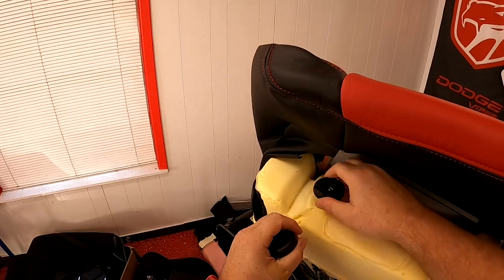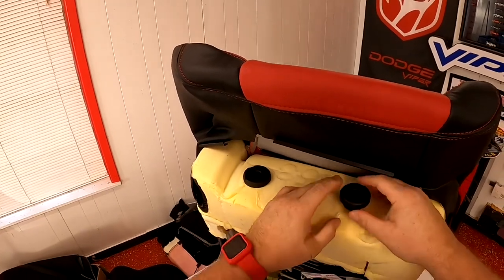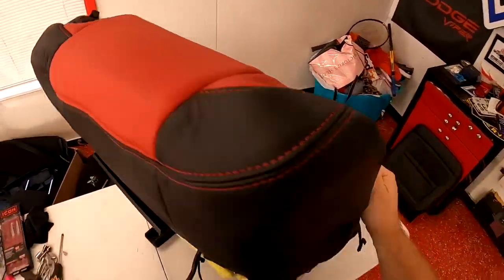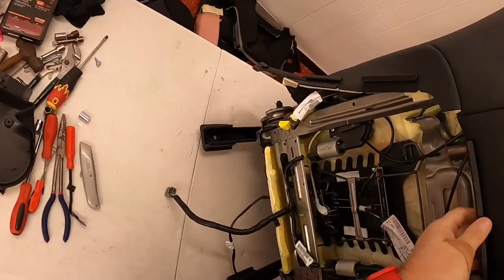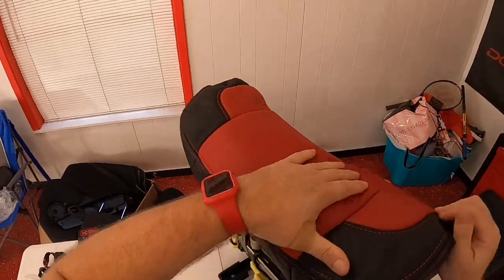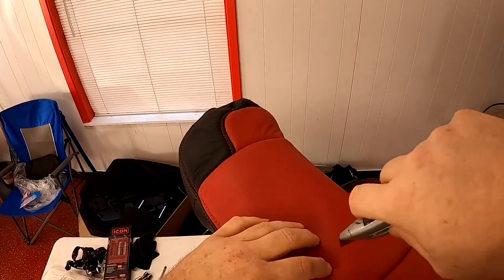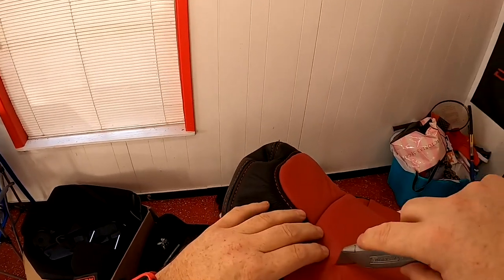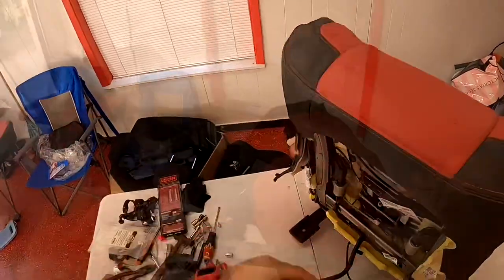If you're doing good so far, this is the part where you'll start to get nervous — you're going to have to cut some holes for the headrest. I put the posts in temporarily to have a better feel of where to cut the holes. Tuck the seat down where it's going to end up being so you can feel exactly where those holes will line up. With the posts in there you can feel very easily where the hole is. Then I cut just a little bitty guide hole so I had somewhere to start to put the two holes, then pulled the cover off.